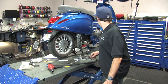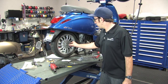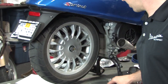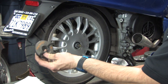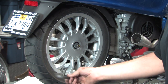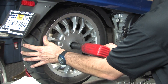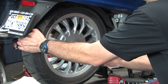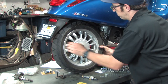I already have the muffler removed — we have that Akrapovic pipe, and I've left the header in place, it's loose up there. Pull the cotter pin out of the rear wheel, then remove the cap that secures the axle nut. You can lock the clutch with a locking tool and use a regular wrench to break that free, or you can just cheat and use a air tool — you don't need any sort of locking tool. Remove the nut, then wiggle the wheel off. If it's tight, you might need to loosen your drum brakes a little bit.